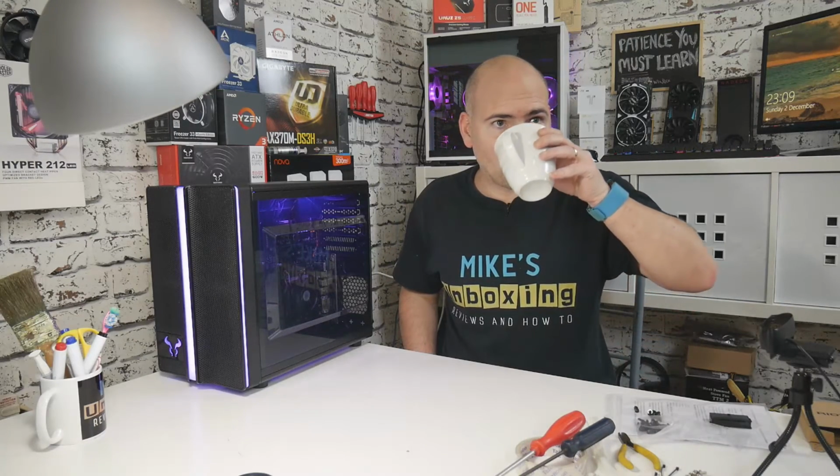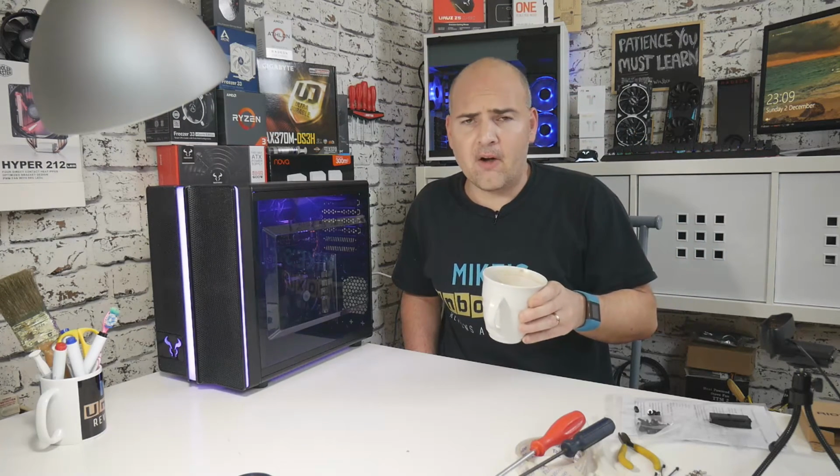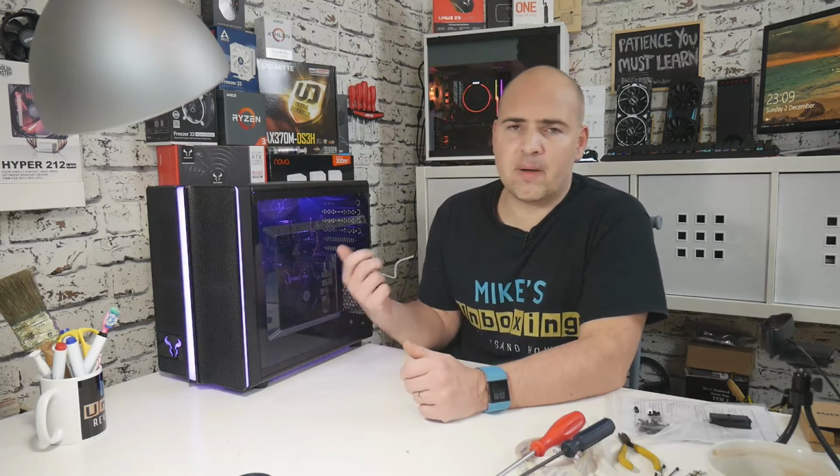Happy days. Hyland said he didn't turn off the power, that would make sense for the CMOS. All right, yeah, power supply thing, the CMOS. Yeah, I did that a couple of times actually years ago when I was trying to clear the BIOS on an old Socket 7 board, because I dialed in some settings which it just didn't like and it just would not boot. And I was there for ages. I even took the battery out loads of times, left it out, and it then dawned on me that the power was still actually getting to the motherboard regardless, because the power cable was still connected and it was a power supply that didn't have an on-off switch, and I didn't comprehend that that was the deal. So I learned the hard way. We all do. If you don't make mistakes, you'll never learn.